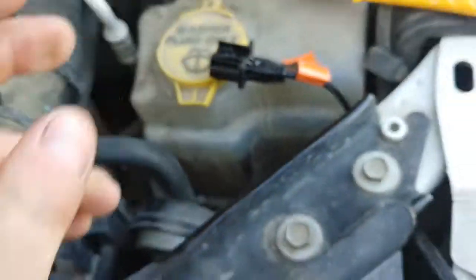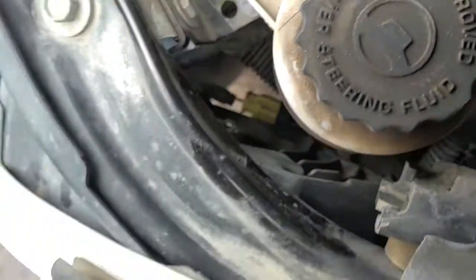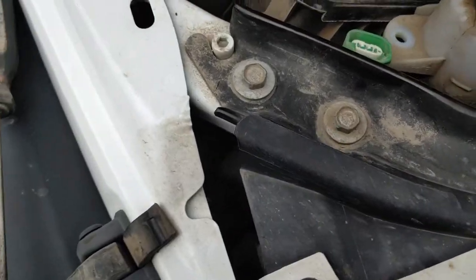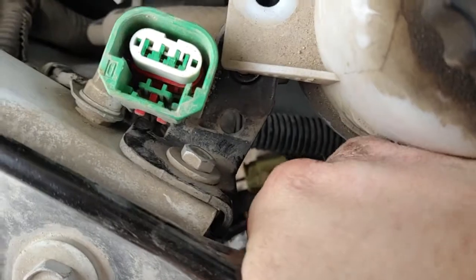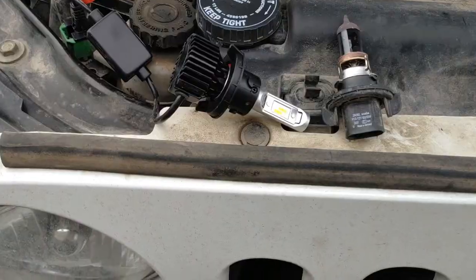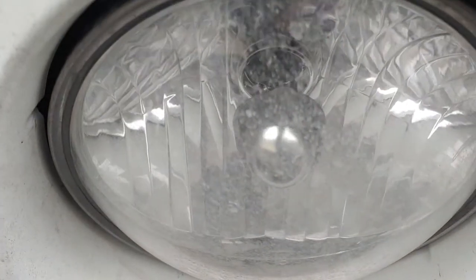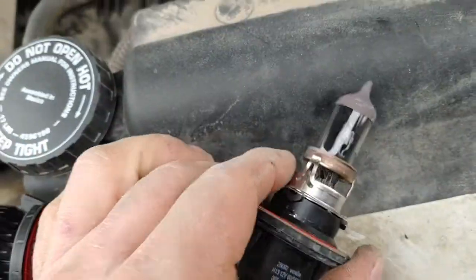With success of not having to take the front grill off or pull the headlights out, I was able to just take the air box lid off and loosen the power steering fluid tank — one 10-millimeter bolt — and you can reach down there with my small hands. Now I'm gonna put the new one in. Out here with better light you can see the LEDs: it shines on the front one for dims, so it's more in that cup, and then it shines on the back ones for brights.